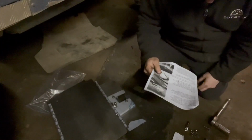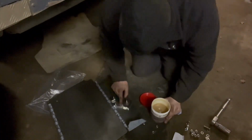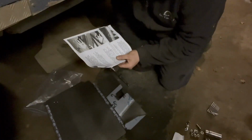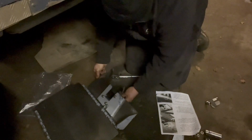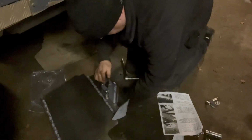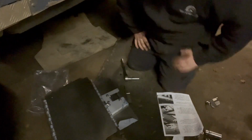It does say lubricate the lock parts, then place this lock cover over the 3 screws. So we'll just quickly whip this off. Okay, so now we've tightened them, we've got to loosen them again a little bit to allow this to turn freely. Brilliant. Slacken them by 1/4 of a turn apparently. There we go. Right, so now it's turning free. Okay, so that's that.